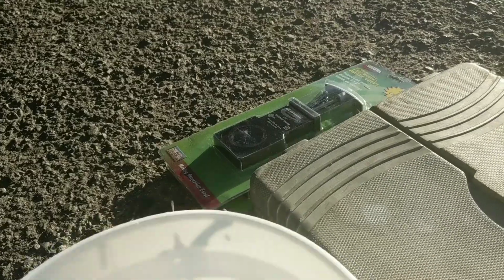On the way home from the dump station, I left the valves open a little bit, as much as I could, and there's an end cap. So anything left over in there moved down to the end, and now it's in the end cap. We're going to go out there, I'll put a bucket underneath to catch what's left, and then I'm going to go ahead and change the valves. So that's what we're going to do.